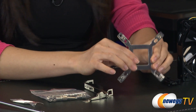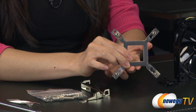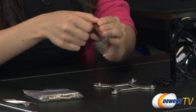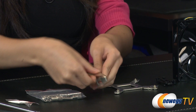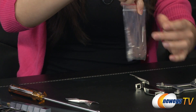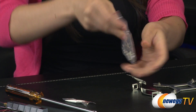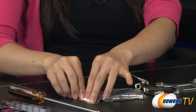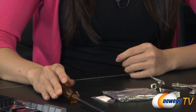Here is the back plate for Intel LGA 1366, 1156, 1155, and 775 socket setups. The AMD mounting clip, and in this bag for your LGA 2011 socket setup we have your brackets, a different set of brackets, and these spring-loaded mounting screws. Finally, we have some thermal compound. A screwdriver is not included but you will need it to secure everything into place.